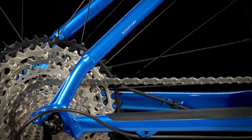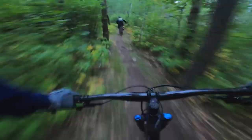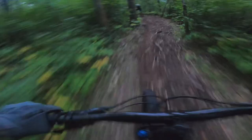On the shifting: it's 12-speed with a 51-tooth cog on the back. It's a mix of XT and SLX. Honestly there's not much difference between SLX and XT — the SLX still shifts superbly well. The rear derailleur is XT, so if you ever wanted you could easily upgrade the front shifter to XT for slightly faster shifting and a little less weight, though most people wouldn't bother.